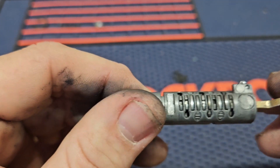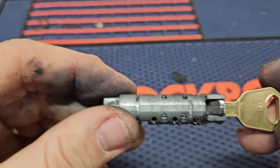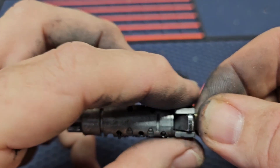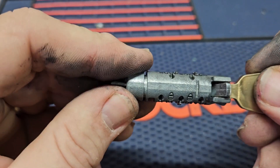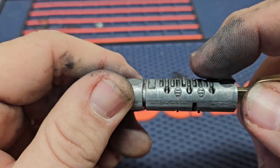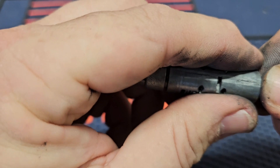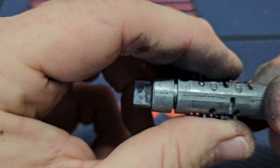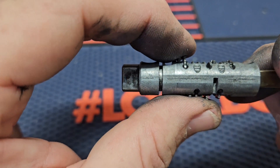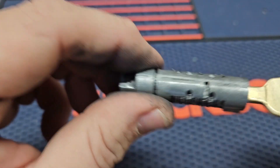It's kind of exactly what I thought. Here's all the tumblers, top and bottom — ten total. Right there is the sweet spot where all the tumblers are flush top and bottom. When you push the key in all the way, that one is too tall. The key is just going in a little too far. If I pull it out a couple notches, you can see what it looks like when the wrong key is in it. As you push it in, everything smooths up, which allows it to turn.